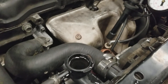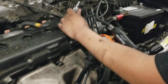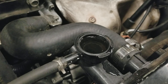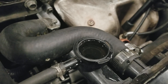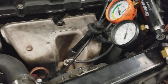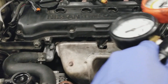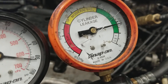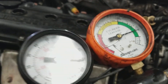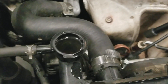That's good enough. Number one to top dead center. As soon as we plug it in, the coolant level starts to rise and it's bubbling. Look at your reading — it's only leaking around 18%. It's going through your head gasket.